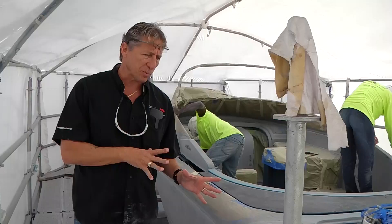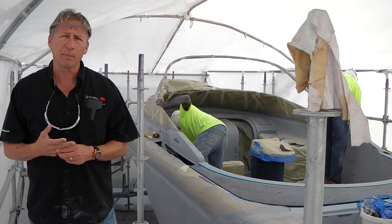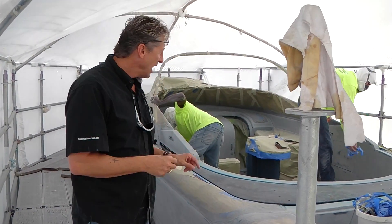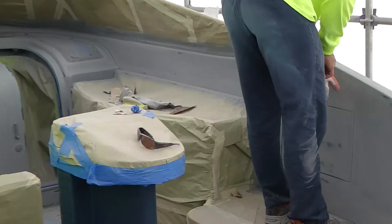This has gray 545 finish primer on it. The hull is going to be sprayed in two coats of blue and two coats of clear — MS600 MS1 clear, which is a high solids acrylic. The inside is going to be done in metallic silver blue on the wall and metallic silver on the inside.